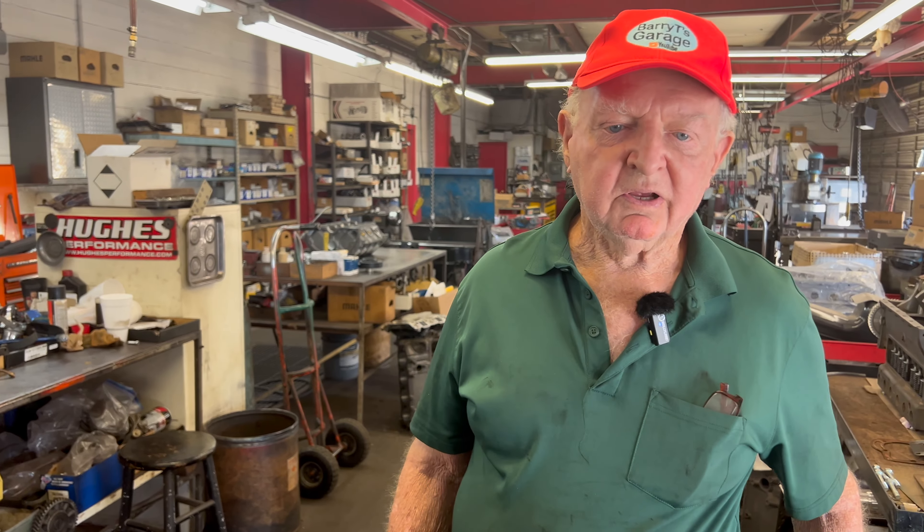So this is some of the things on it - it's really unusual. Even in those early days of the first Model T's, a buyer would say no electronics, I'll crank it myself - no electric starter. So in the first few years, they didn't have starters and there was no place for the starter. A couple of years later, maybe in the 1917 or 1918 models, they put a cast place for the starter. So you could get an optional starter - it would be a six-volt starter - and you still kept the crank too. Then you could probably get a little better lighting system as well.